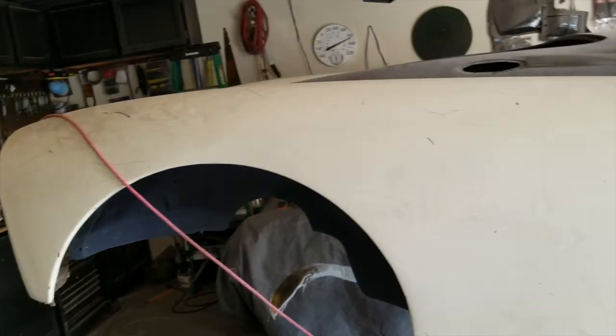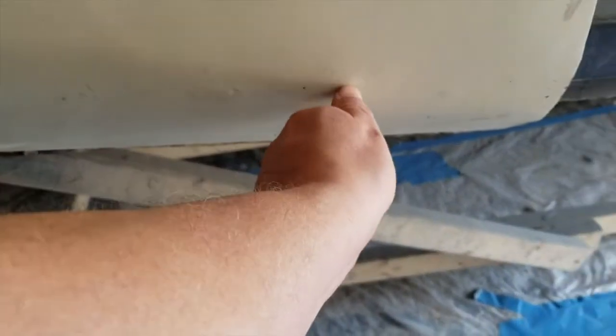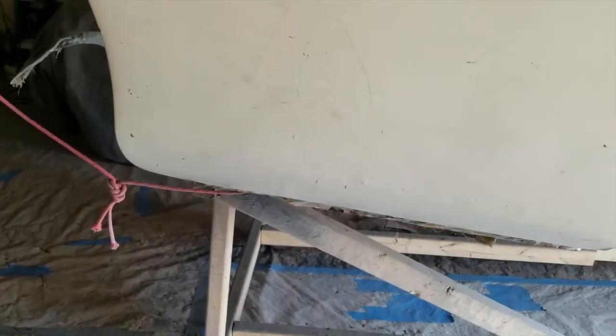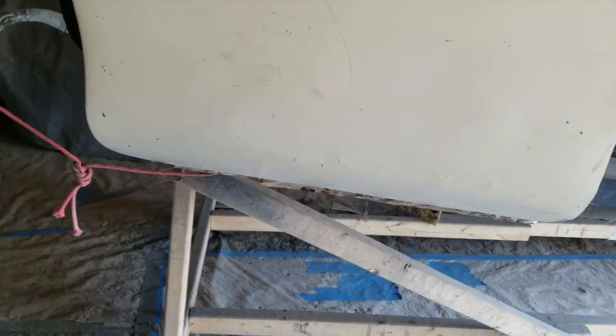But it's the fenders that I'm a little bit curious about. I know I've got some bubbling in there. That means rust. But again, that's easy to fix. I'd strip that, grind the rust out, then either fiberglass into it, that tiger hair stuff, or put in patch panels. So we'll see. That'll depend on how gunky it is.